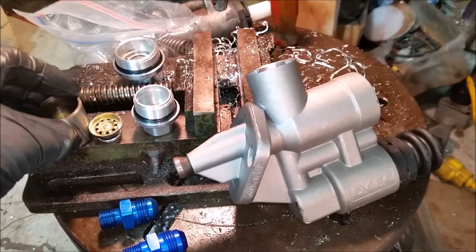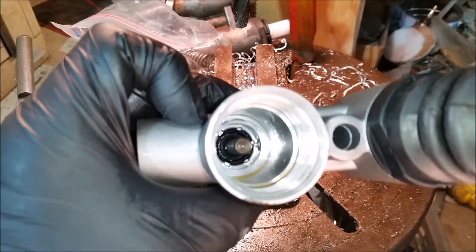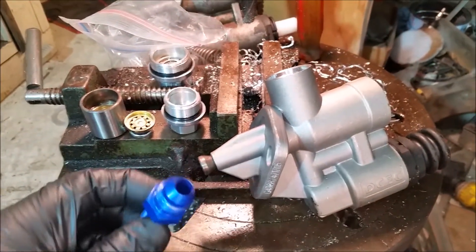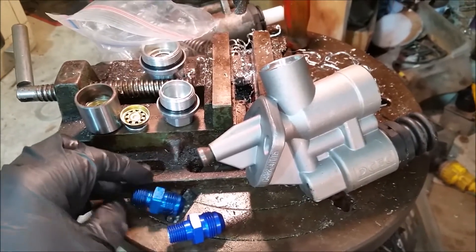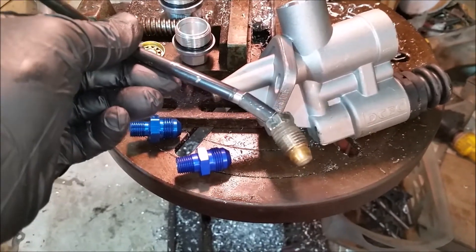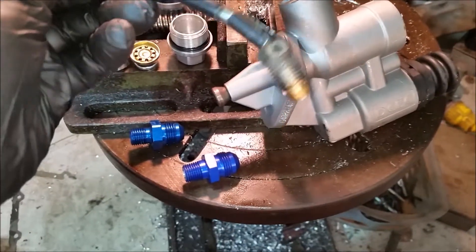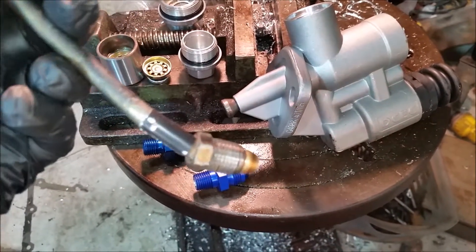That's a rundown of how to take a Carter 12-valve lift pump and address some of the inefficiencies, and our solutions to try to get better flow out of them. Let me show you the factory line in comparison. This is one of the factory outlet lines for the 12-valve — it would normally go up and into the fuel canister. It's M14 with a little brass ferrule fitting, and we're going to use pipe dope, rated for diesel use.